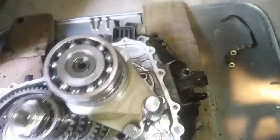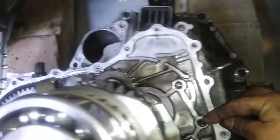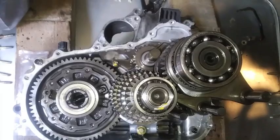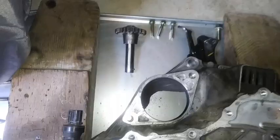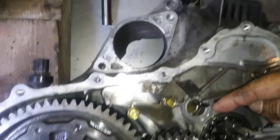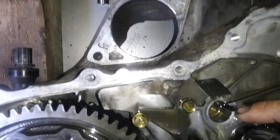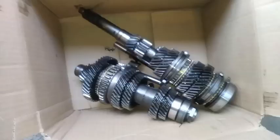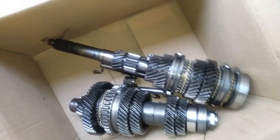So I took off the bracket that went here — it's on the floor. Now I'm going to take off this gear. After that, the gears are going to be able to come off. There's a gear I just took off from right here. It has a slot — that little pin goes right here, and there's a flat surface on it. I'm going to get ready to take this whole gear set off. These are all your gear sets — I just put them in the box. This is how your transmission looks without the gear sets. Now the differential is ready to come off.